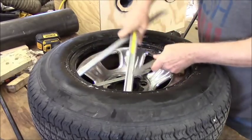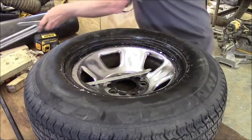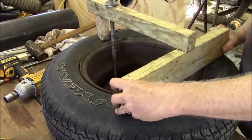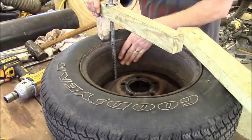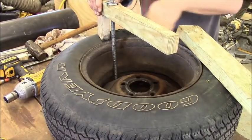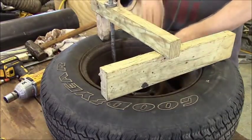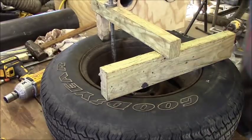There she comes - that was extremely simple and easy to get that side off. Now I gotta bust the bead on the other side. Sometimes the back side of the wheel is harder to get off because it's flat for quite a ways here. So when I push this down, this bead probably isn't gonna break - I'm gonna have to rotate the tire and push it off where it's been sealed. That's normal - on the other side they drop off into that big trough and pop right off. This side's a little bit more difficult most of the time.